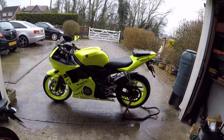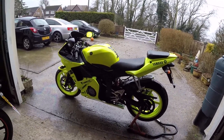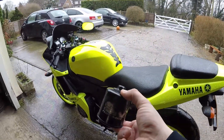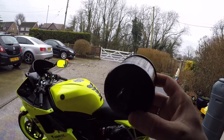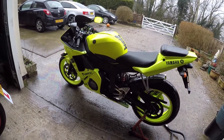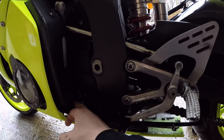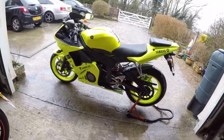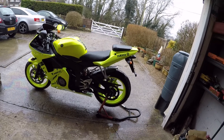Be careful with the filter - if you don't want to remove any fairing, you need to buy proper filters. These are K&N filters - this is the K&N performance filter, and you see this little bolt on the back, it's a 17mm so you can use a spanner to undo it easily. I bought a cheaper one to save money but ended up with more trouble replacing the filter since it came with no bolt on the back, requiring a special tool to tighten it. Make sure you buy a proper filter - it will last longer anyway.